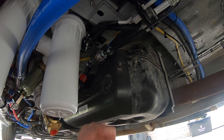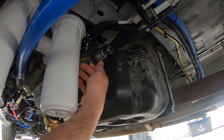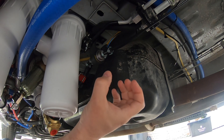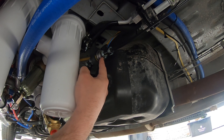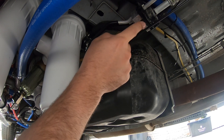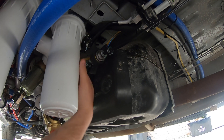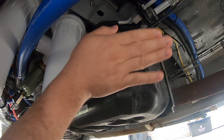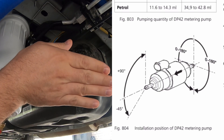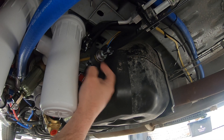You can see our fuel pump here where we placed it — they provide a little rubber clamp for it to fit into, and it just holds it there. The most important thing is to make sure it's free to wiggle and not hitting anything. Also make sure it's on an angle tilted in the direction of flow, so no sediment has the ability to get stuck in that pump.